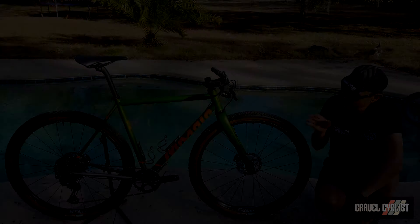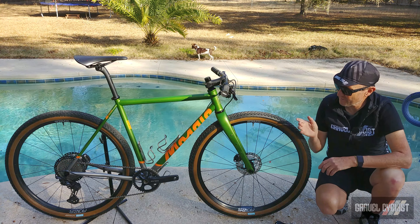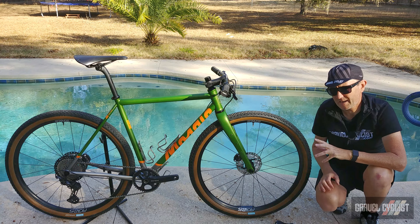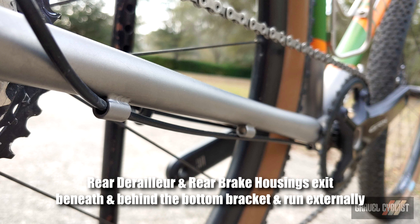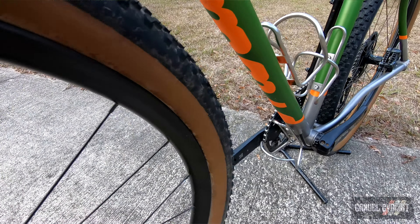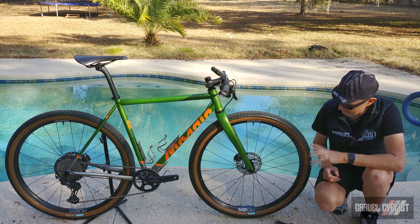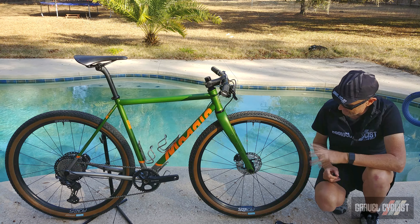Going back to the crankset, the bottom bracket turns on an English thread bottom bracket with external cups for the Shimano bottom bracket — a no-brainer, super easy to install and very reliable. Regarding the frame geometry, I'll overlay the geometry chart on screen. I really like what Mosaic has done with the paint on this bike — part of the frame is naked titanium and a lot of it is painted in a pretty fetching forest green semi-gloss with orange highlights for the branding and model name. There are also fender and rack mounts on the frame and fork, and everything is internalized including the hydraulic brake cable running inside the fork and the shifter cables for the single derailleur on the non-drive side of the bike. Really clean execution.